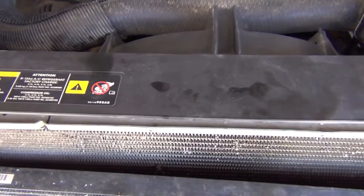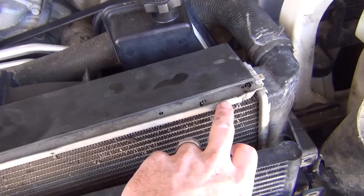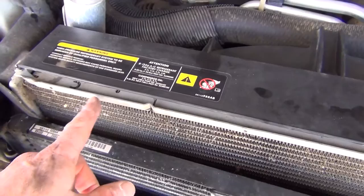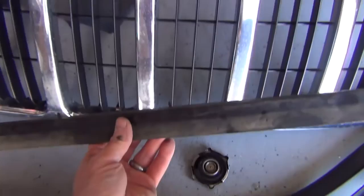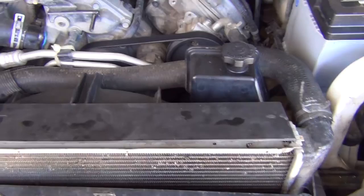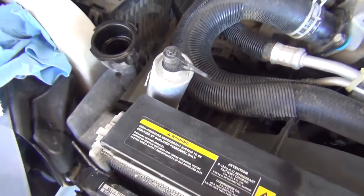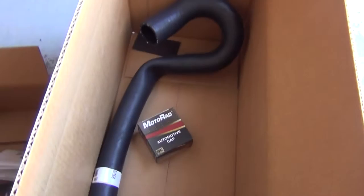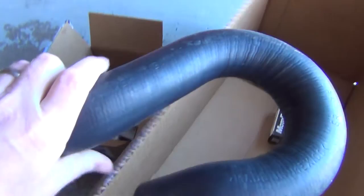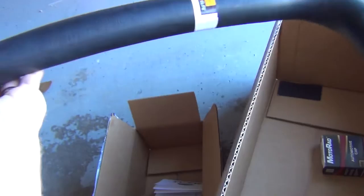I went ahead and popped the lower hose with a bucket underneath so it's draining. I also took the overflow tank and the rubber trim piece off. Be careful — I broke one plastic tab when I pulled it. You'll want to use a screwdriver and push on the remaining tabs from the get-go to avoid breaking them. Those tabs do transfer over to the Spectra. I'm going to do the upper hose once the lower one stops dripping.